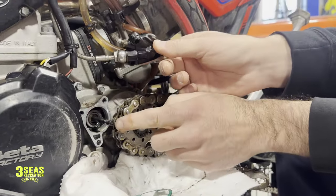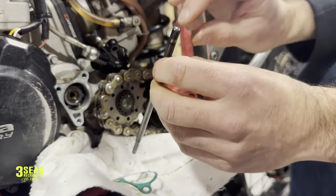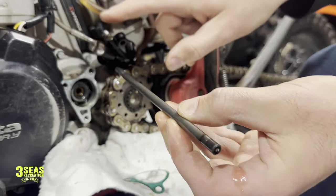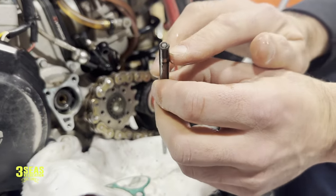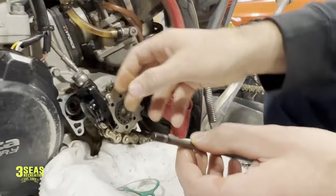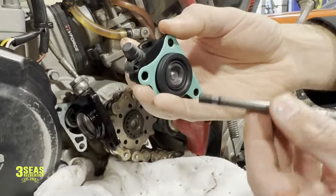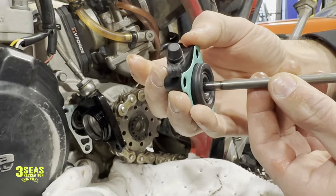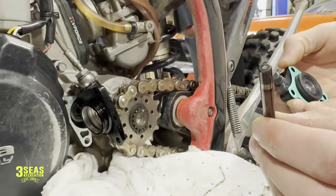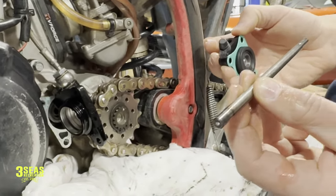This is your push rod here that goes all the way into your clutch on the other side. This is not part of this video but I want to explain it. If you're also experiencing some clutch fade — Jared's bike is a perfect example — you can see the dimple on the end of our push rod. This is going all the way over to our throw out bearing on the clutch basket. This little ball right here is what's pushing on this, and I can feel how it's naturally centering itself. You might want to grab a new one of these as well, because the wear on that rod can actually make a big difference on your clutch feel. I think these are like $20. I'll probably order one for Jared — whenever we're doing this, we always do this as well, just to make things better.